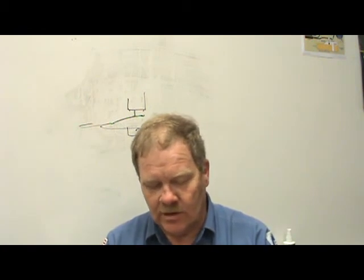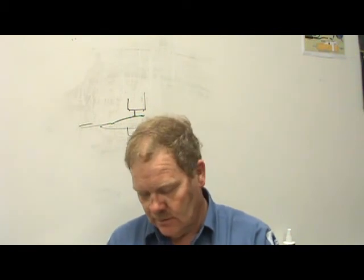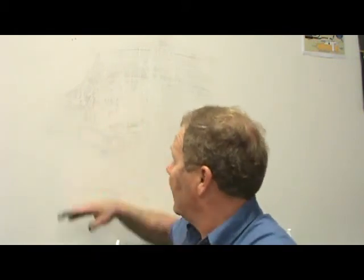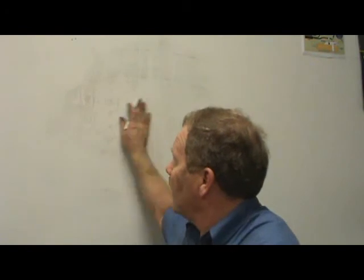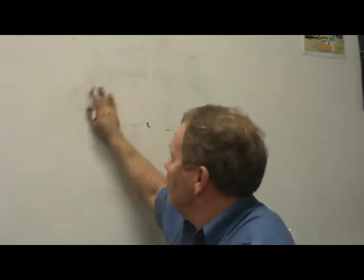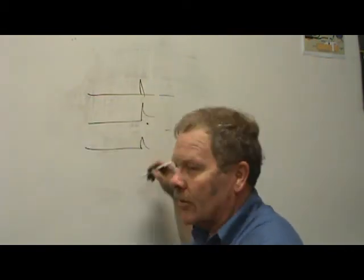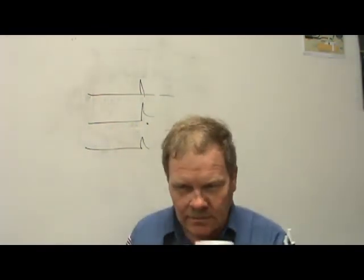Ignition oscilloscope screen showing all the cylinder traces one on top of the other is superimposed. That's not rocket science, is it? Superimposed. Now, when you're looking at a scope pattern and they're lined up and you're looking at all of them like that, that's called a parade, okay? Whenever they all are right on top of one another, in other words, it looks like you're just looking at one, but you actually have them all stacked like this, that's superimposed. If you've got them laid across the screen like this, with the final line like that, that's called raster, okay? So those are the three capture patterns you have, okay?